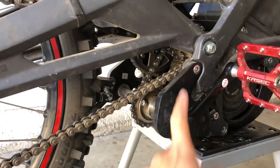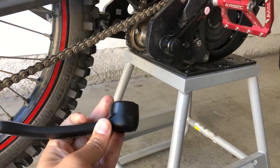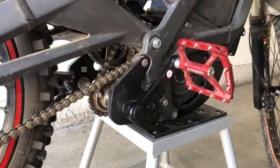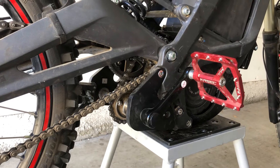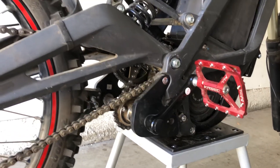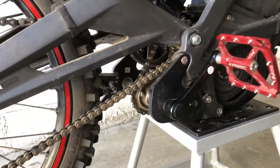I would order the power pedal kit without the cranks and without the pedals, unless you're super concerned about weight — the stock aluminum ones are really lightweight but have a bigger footprint than steel. The unicycle.com four-inch cranks are better in terms of avoiding pedal strikes; my pedals aren't hitting things on the trail anymore, which is a big factor when you're going through technical sections on a bike that weighs 120 pounds. Make sure when you take stuff off to mark your bolts so you can keep an eye on whether they're backing out. Alright, have a good one everyone, ride safe.